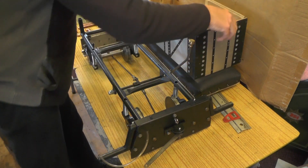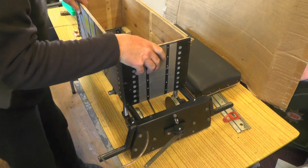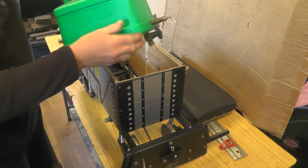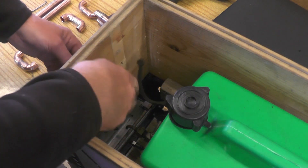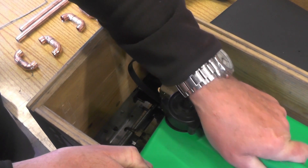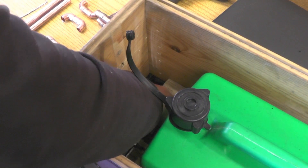Right, so let's deal with the ground level track first. I'll fit my extension box on - when I made my box I made it to the dimensions of this petrol can so that it just slides in and rests on the frame. To stop the tank moving around in the box I've put some wooden blocks on the front and back so it's resting on the frame and can't move. Then I'm going to thread the feed pipe through this gap in the back of the box and connect it onto this pipe.